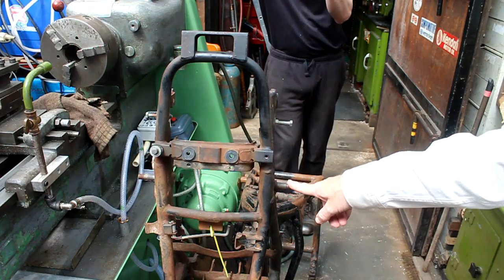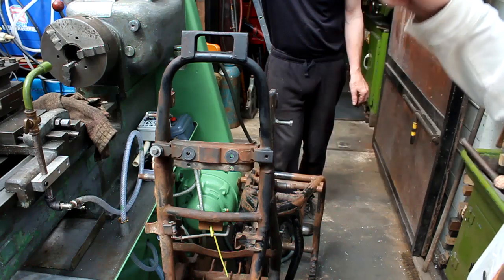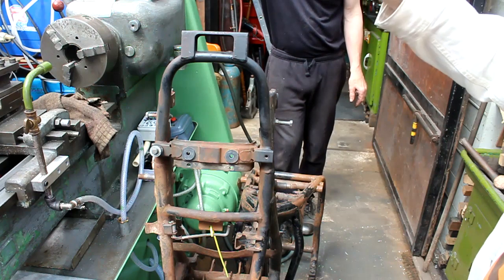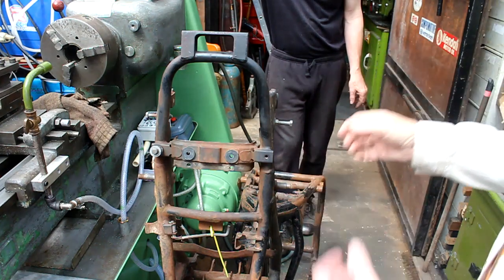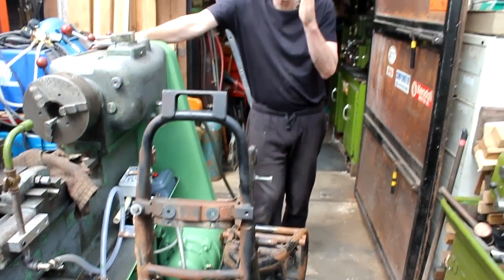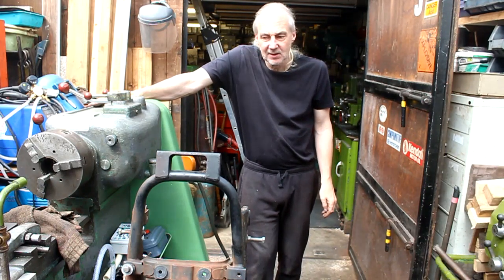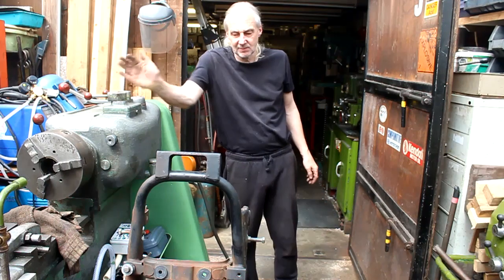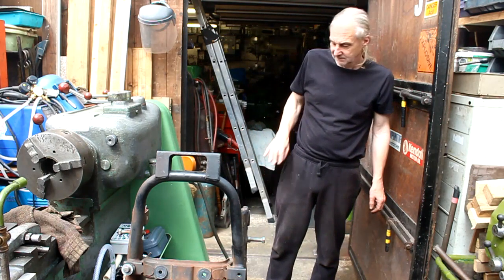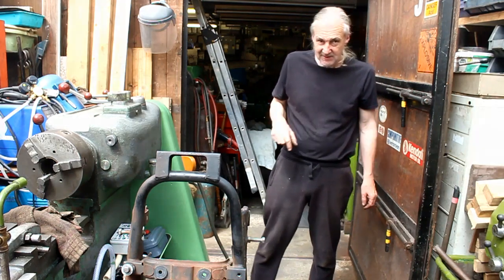I think what Les did was he removed the inner steel tube that's in the top shock mount, so it goes straight on, keeping that extra room, which I don't want to do. But if you do that, you can't bolt them up tight, or they'll end up crushing. So it's all a bit up in the air. But all that's for another day. So now we'll stop here and continue the video maybe next week when you've got a bit more done.